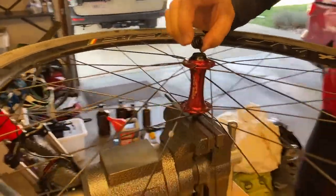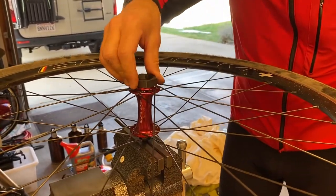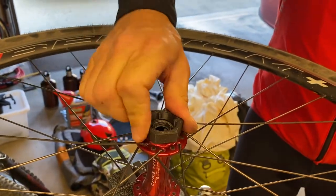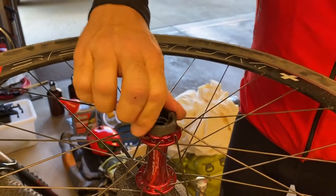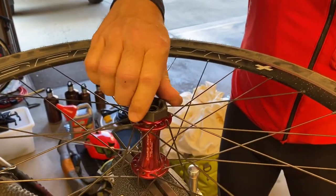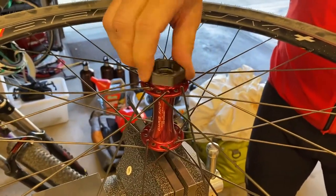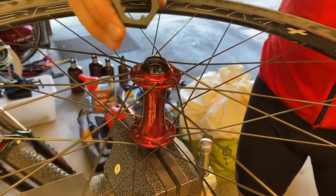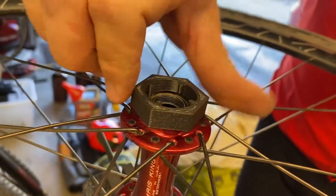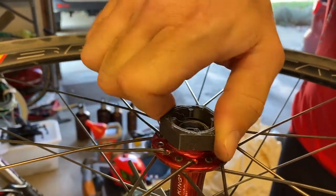When you pop it, it will take a lot of force to actually come out. Take this piece off and then from there you adjust the preload on the bearing — this actually eliminates squeaking of that hub. The way you're supposed to do it is push it down finger tight. I've done this a few times; I have about 150 miles on this wheel, it's basically brand new. It started squeaking probably about 50 miles in and I've adjusted about every 50 miles after that. You can see how the little teeth inside there engage right onto that part. I'm just finding where it starts to get tight, and it's finger tight — that's it.